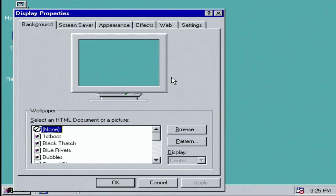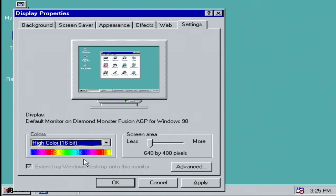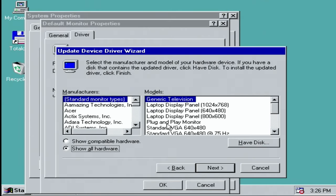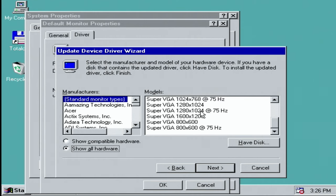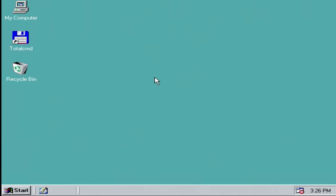Right off the bat, I had lots of problems with drivers. After a Windows 98 clean install, I tried all possible drivers I could find, on all the cards I've got, and I couldn't set either card to a higher resolution than 800 by 600, 16 colors. The culprit was a monitor driver. I had to change the default monitor to pretty much anything else. Never experienced a problem like this before. While testing the cards further, I found out 800x600 resolution doesn't work with reference drivers for some reason, but works fine with official Diamond or Creative drivers.